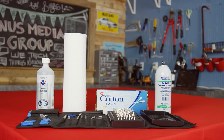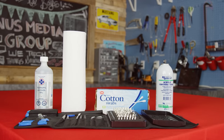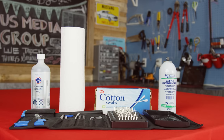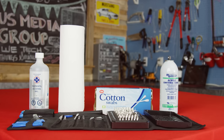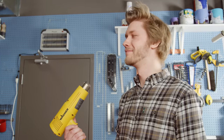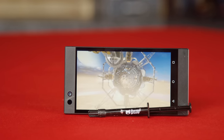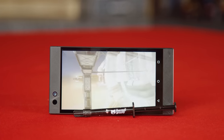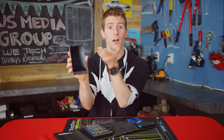To get started, you'll need a good set of screwdrivers and prying tools, some isopropyl alcohol, paper towel, conformal coating, cotton swabs, and a heat gun — because getting inside phones sucks. And of course you'll also need liquid metal; we'll be using Thermal Grizzly Conductonaut.